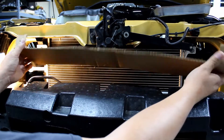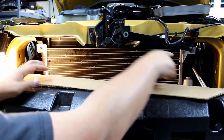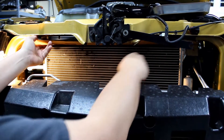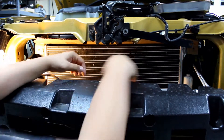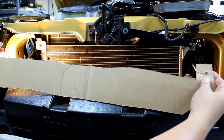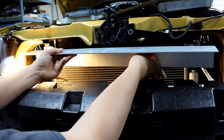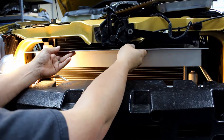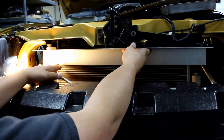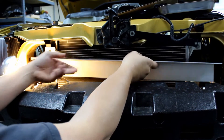I made a cardboard template — we're going to use two screws on each side to mount the oil cooler on a plate. That gave me rough dimensions. After I had the dimensions I had them bend me an angle piece, because making the other piece would be too expensive. Now we're going to go through the process of cutting all the reliefs and getting this mounted on those two screws.